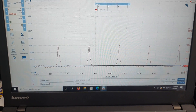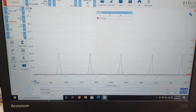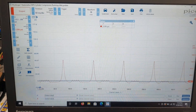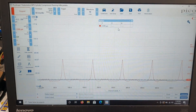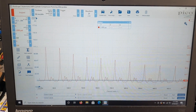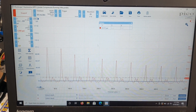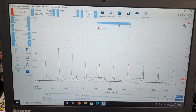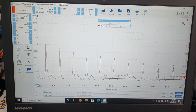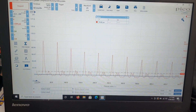Let's have a look at the exhaust back pressure at idle — it's already about 3 psi, which from rule of thumb you probably wouldn't want anywhere near that; under load 2-3 psi is the absolute max. Going forward to when we revved it, we can see the pressure rises to around 20 psi — obviously that's proportional to how much you put your foot down on the accelerator. That clearly shows 20 psi of back pressure, and it's a great reading with a pretty nice looking waveform.